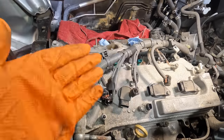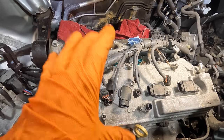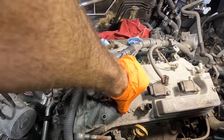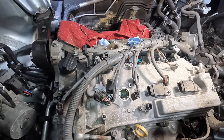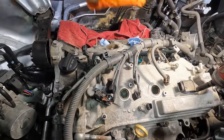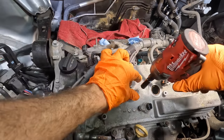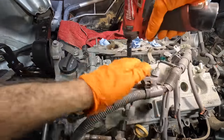It runs down. The clean side of the oil system on the engine is actually what is happening after the filter. See, oil is picked up from the sump, from the pump, and it's pumped directly into the filter. As it leaves the filter, that's when it passes into the block and it gets sent off to the main bearing. After that, it runs up top to the cylinder heads, gets sent to the camshafts, the VVT, and any other components. So no matter what, all of those critical specified components inside the engine are always receiving clean oil. Unless the filter's clogged and then it starts bypassing or something, and then that's a different story. But for the most part, everything is always gonna have clean oil.